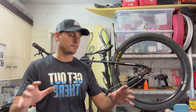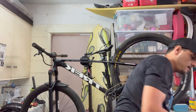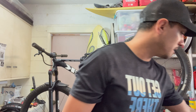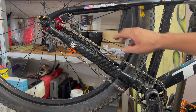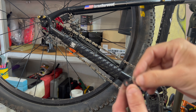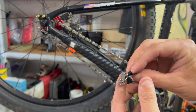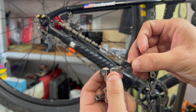So the trick is you have to go by even numbers. The cog is a 12, and the gearing in the front with the crank is also a 26. Before, I had an 18 — even number. Also 16 — even number. When I had odd numbers, like a 13 tooth, I had to have a chain tensioner. So if you have a 26 up front and a 12 in the back, you can fit the chain perfectly. If you have a 13 tooth in the back, that's not going to work, because you can't just take off one link. These chains basically have two links — anytime you cut, you take two off like this. If you try to take just one off, it's not going to work. You need this to slide into here.